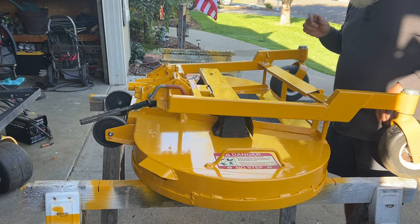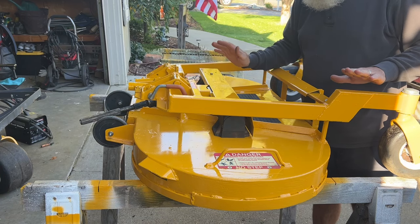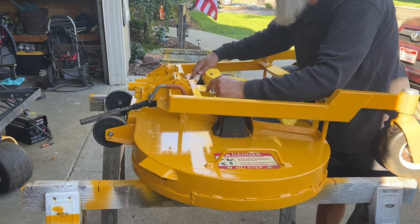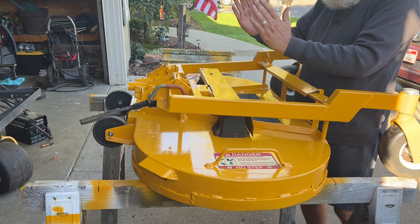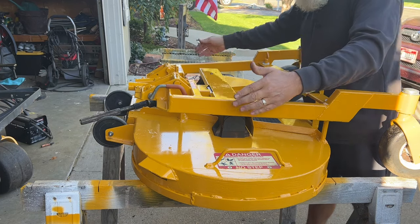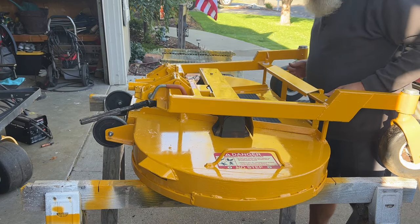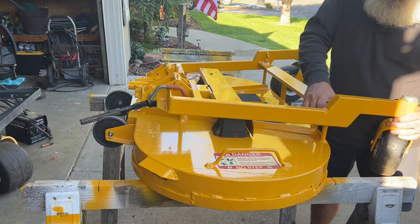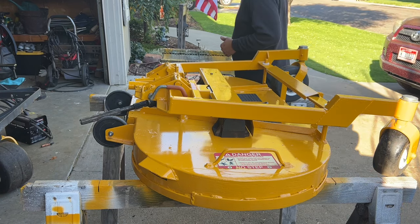And we thought that might happen. These pins are off just a hair. But we knew that was going to happen, guys, because I didn't even tell you, these were all re-welded too, because they were cracked out. And so when my son had it, he just kind of had to guess and re-weld it. And he put them at vertical, but who knows, the carrier might be bent. Maybe these are just off of here. So the front ones look to be all right. Yeah, the front ones seem to be okay. But let's get the modifier out, fix these things.